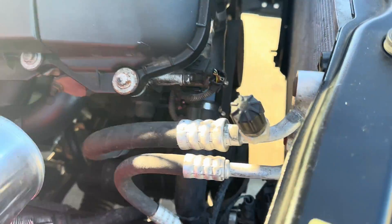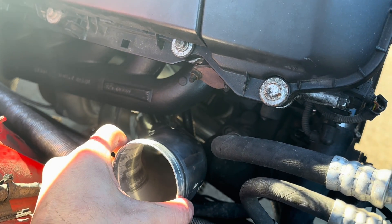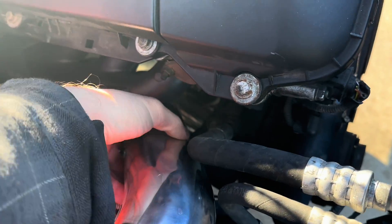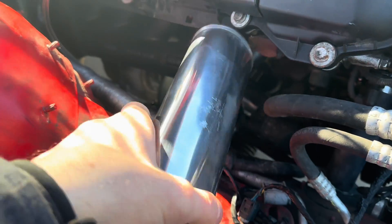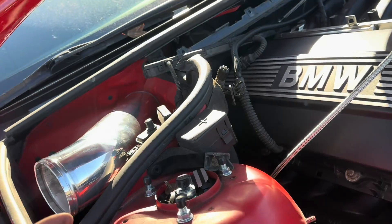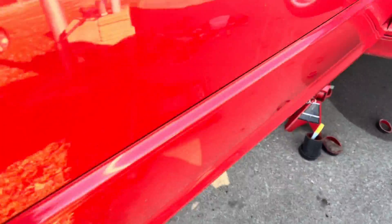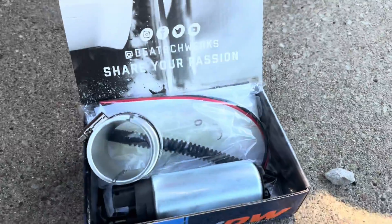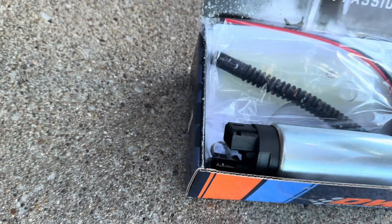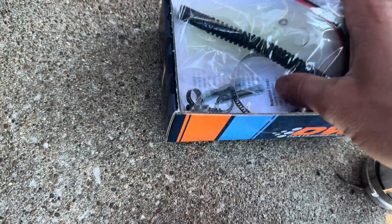I was working on the pipe for the intake and air filter — all it is is a three-inch pipe. You do want to oval the midsection to get more clearance and stay far from the turbo manifold. That's kind of where I left off. Before I continue working on the intake, I'm going to go ahead and install the fuel pump I just showed you. I have the back seat out, I'll pull out the sender unit and get this together and show you what it looks like.